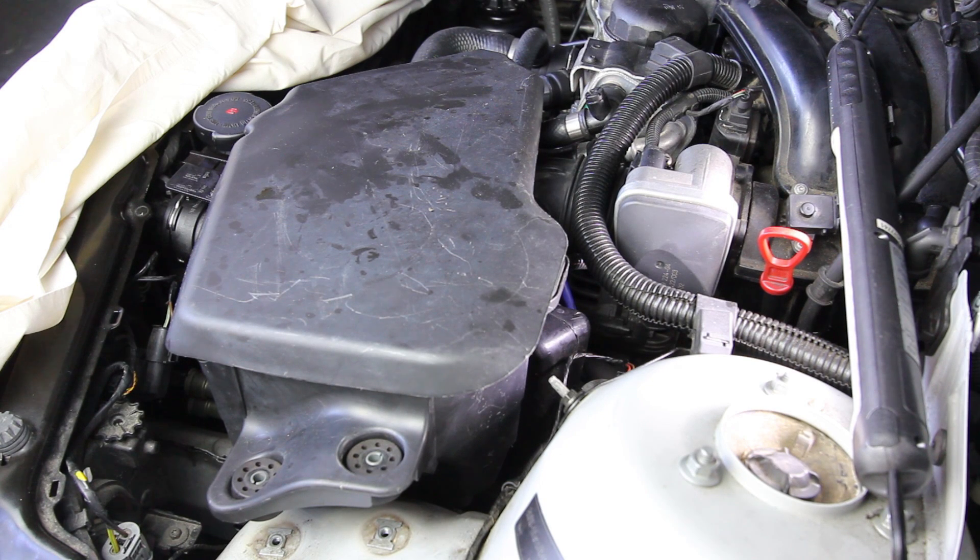I have a feeling I've gotten rid of most of the oil. It's gummed up places and now it's kind of all stuck in the overflow. It's also got to come out anyway because the overflow section of the upper rad hose — this little tiny offshoot piece — is leaking. I've been told that oil being in the water system can make these o-rings swell, leading to a very small leak, which is what I've got. So I have to dismantle it, degrease it, clean it, and then re-o-ring it. Hopefully that sorts it, otherwise I'm going to have to look at replacement bits.